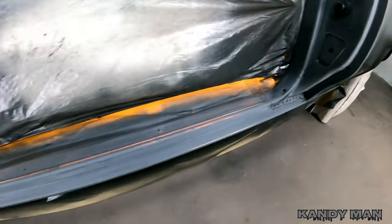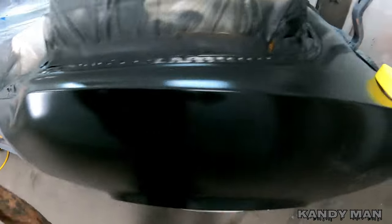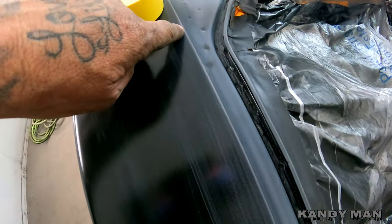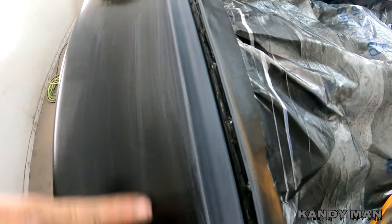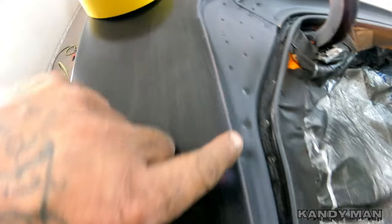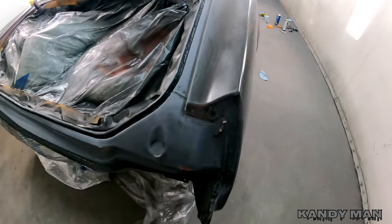We got the jam sanded out and went ahead and started taping them up because I'm going to re-bag this again and tape right along the edge. When you guys tape this, tape right along the edge — don't come out too far because then you got to sand that line off. Kick it right on the edge when you tape it, and that way when you go to sand it, it comes down nice and easy because you're going to have quite a bit of build with this candy since you got a lot of layers of paint. Just the tip: don't tape it too far in but make sure you tape it close to the edge.